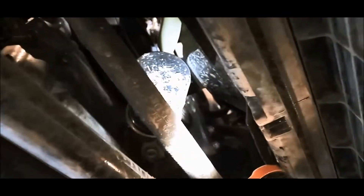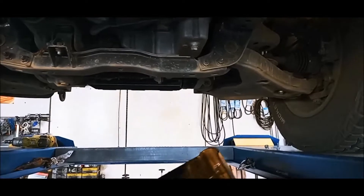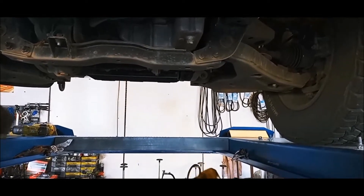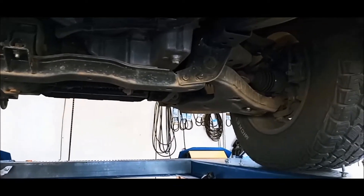While you've got it up, it's a good idea to check for any oil leaks, check your CV boots, anything that might have been hit, and all these cables. That's the drain plug on the motor, and right up the front here we've got the engine oil filter. You'd probably put a slightly larger one in there if you could find one with the same thread — 17 mil — and make sure you've got an adequately sized container to take all the oil.